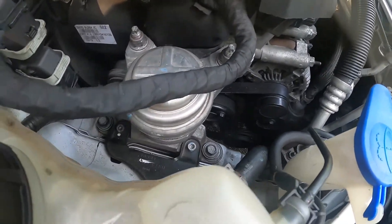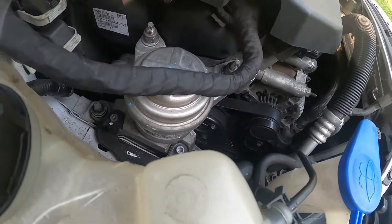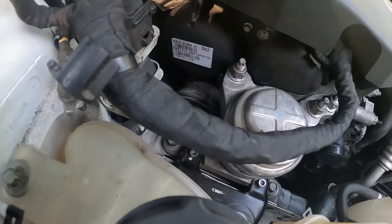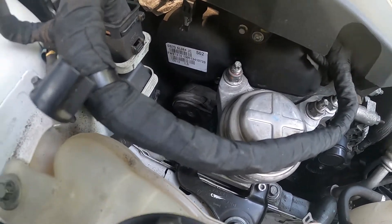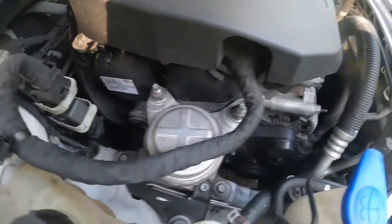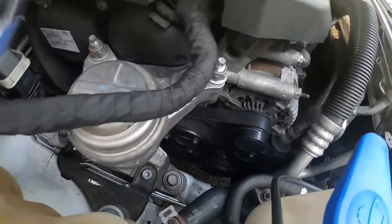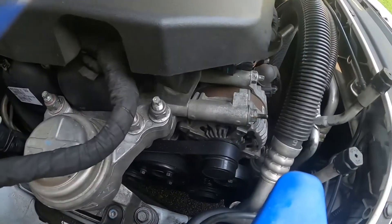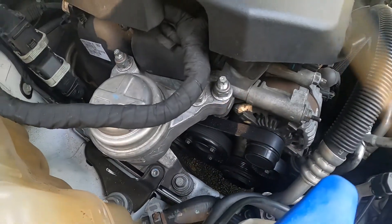This customer wanted just the belt — it was shredding. Once I got it taken off, I found out that the belt tensioner pulley on the inside is damaged, so it's eating that belt. This one will eventually do the exact same thing, but they didn't want to hear it, so we'll be doing exactly what they asked for. Any questions or comments, please feel free to let me know.